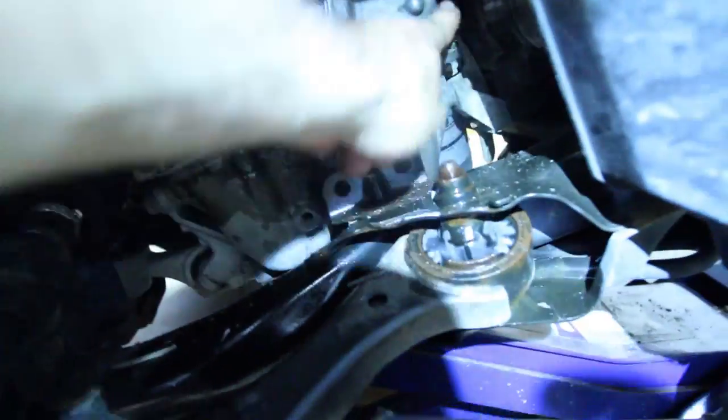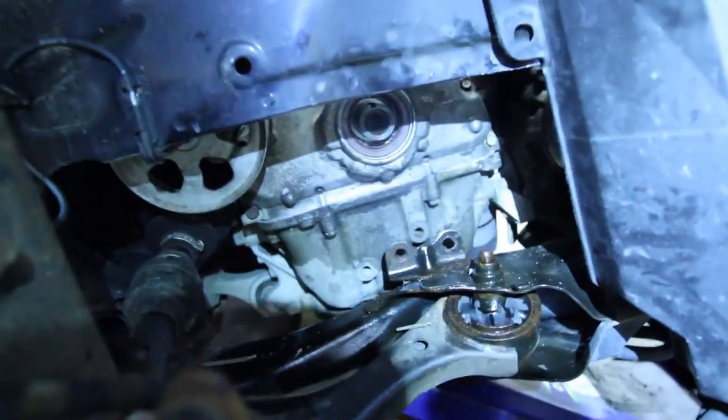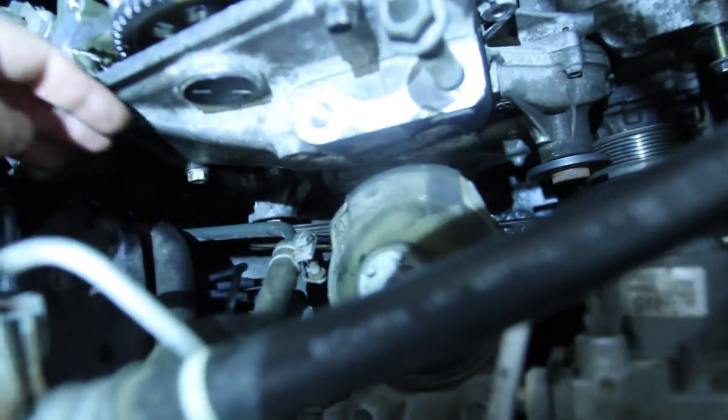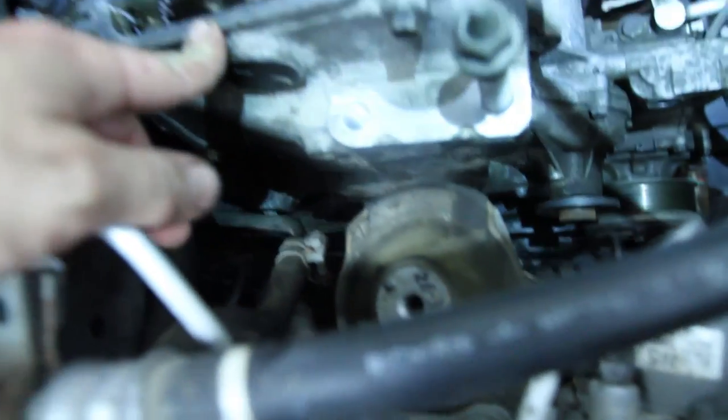All the bolts are installed — the five 8mm bolts and the other ones. There are two up in the bottom securing at 13 Newton meters for those two. One thing I found helpful: I took that lower pulley off and zip tied it to the back of the engine to make room. If you had that pulley on just hanging there, you need to move it to the back to make room — you saw how much trouble I had putting that thing in without it.